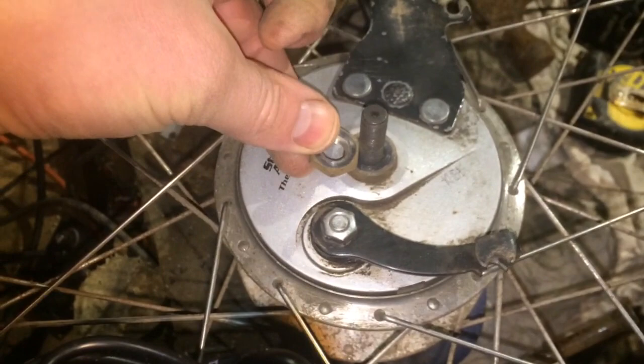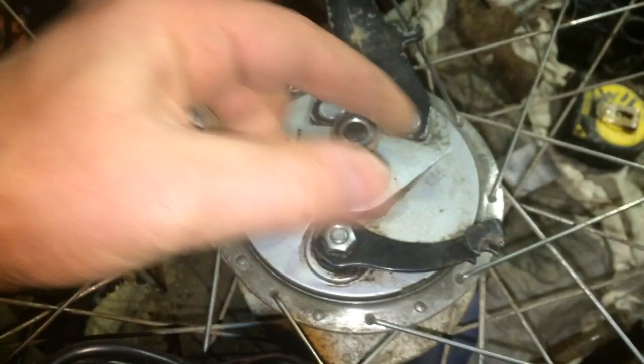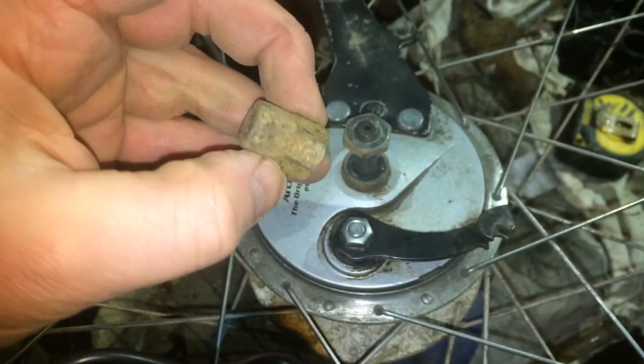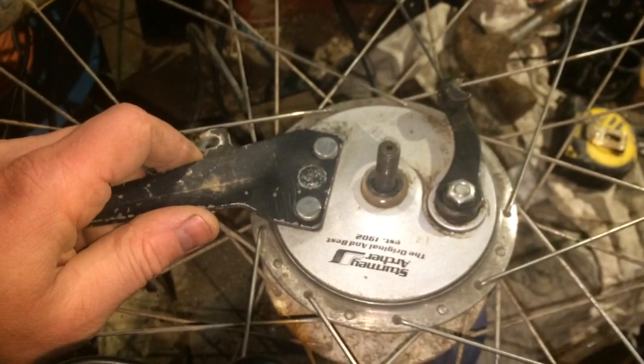But you've got a small locking nut which goes on here. This is what your fork dropout actually squashes onto when you're using it, so that's all the way down there. Your fork dropout would squash on there, and then you have your wheel nut which goes on the top here. It's a bit rusty — it would be better if these were stainless. So you take that off and then this whole bit here will just slot right out.